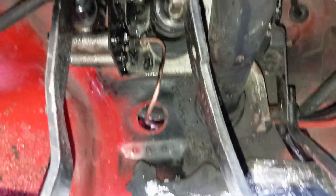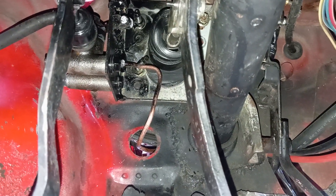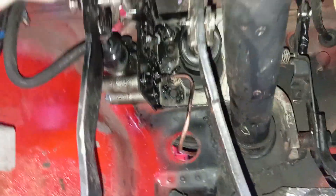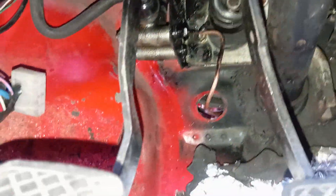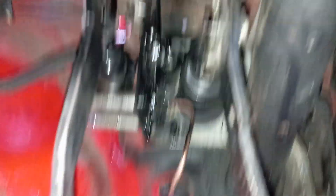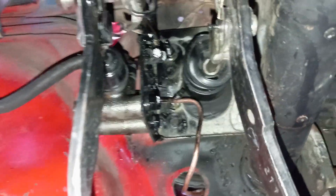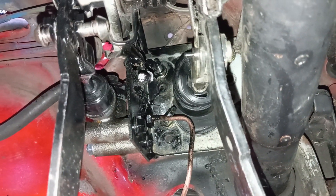You can install a master cylinder — this one comes from a Toyota Hiace. I'm going to post an image of the master cylinder in case you want to do the same thing. You have to drill here in the pedal and get a pin, then make sure you have the right position. You have to take all the pedals out in order to install it.